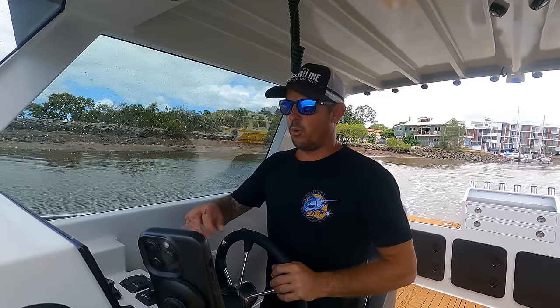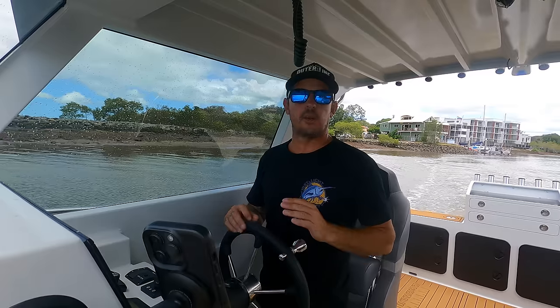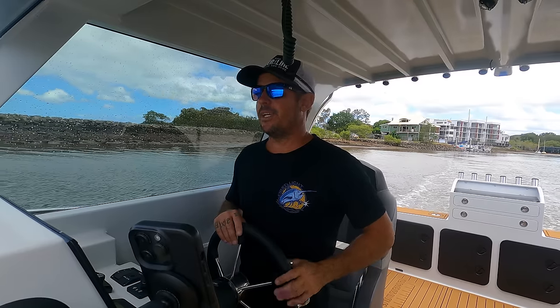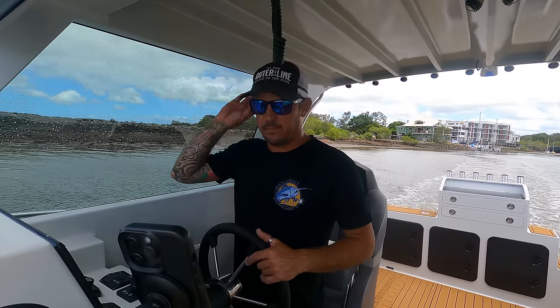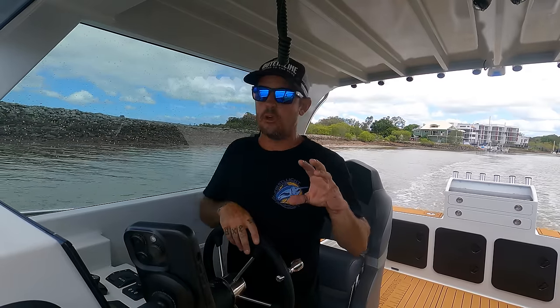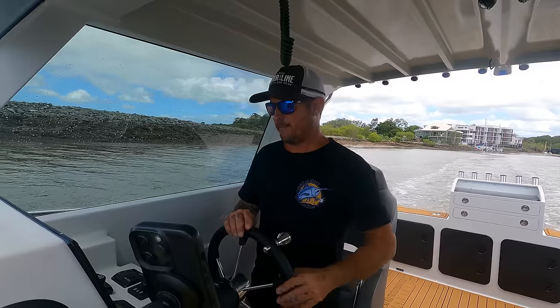All right, so I wasn't really happy with the 15. We got 40 knots top speed. The best fuel economy I could get was 1.4 kilometers per liter at 22 knots, and I just want to get a bit better than that if we can. But the main thing was it was cavitating a bit. You really had to have it trimmed in. Hopefully the motor doesn't have to go down one hole, because it looked like it was on the borderline of it. But let's try this.